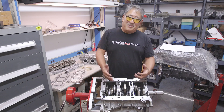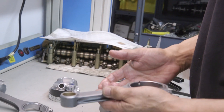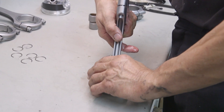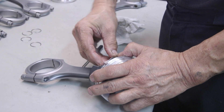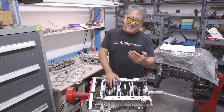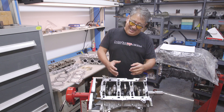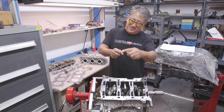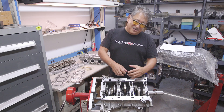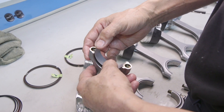For connecting rods, we're running K1 rods. The rod is machined from a blank that's actually a near-net shape forging — this allows really good grain flow around the big end of the rod. With a K1 rod, the forging die actually has the hole in there, so the grain flows around the big end. You get more strength, more even flex distribution, so your bearing life and fatigue life could potentially be better.